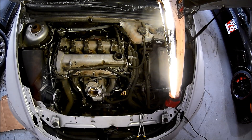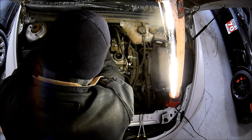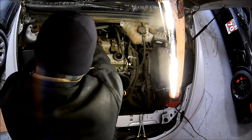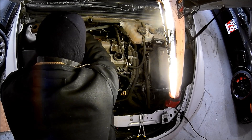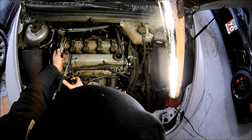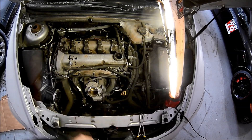What I had to do is use a pair of pliers normally meant for spark plug wires. I don't get a very good shot of me pulling it up, but you do kind of have to twist and pull at the same time because that cam sensor is in there pretty deep. This is a pretty easy fix to do at home with minimal tools. There is oil in there and you see me spill it, so I've got to clean it up.